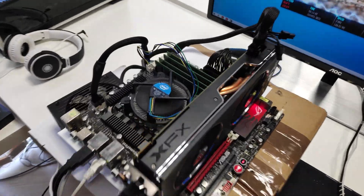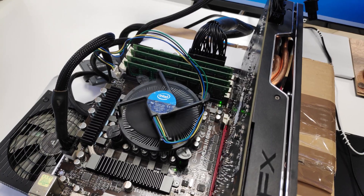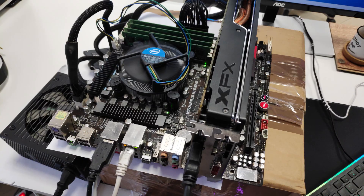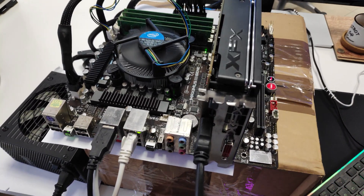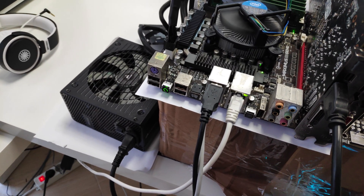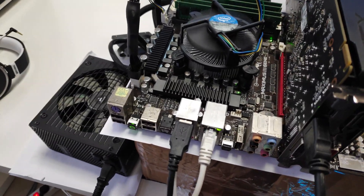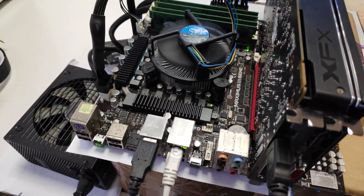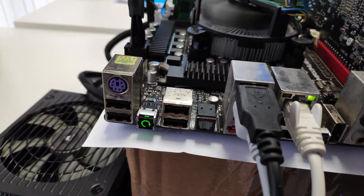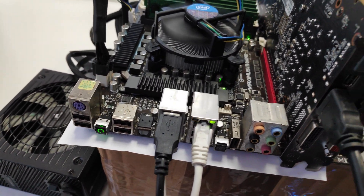I got the motherboard and the CPU for $60 USD, which I later sold for $35, making the real cost of the motherboard about $25. The first problem was that the sound was not working — I guess the onboard audio is gone. The second problem happens when you unplug the power supply or turn it off from the switch. When you connect it to power again, the only way you can turn it on is to clear the CMOS first. Otherwise it won't post at all. I think this is a BIOS failure and I will try some basic methods to fix it.